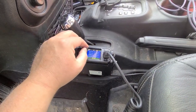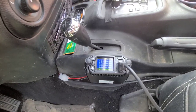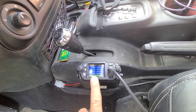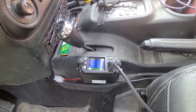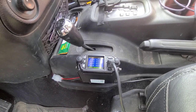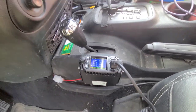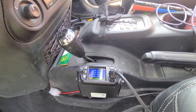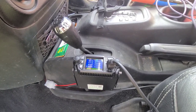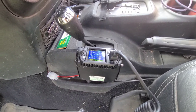My favorite part of any radio install — peeling the label off the screen. You can see our radio is on here, just happened to be on the fourth channel. We plugged in frequency 462.550, which happens to be channel 15. When you hit the mic you can see we transmit, and we already checked this against another radio to make sure everything's working — everything's transmitting just fine. We know the antenna's working, we've got good range and good sound out of this. We'll use Chirp to program this radio via computer.